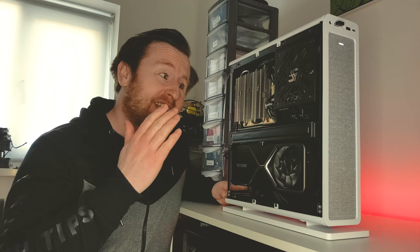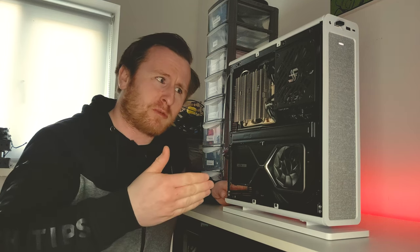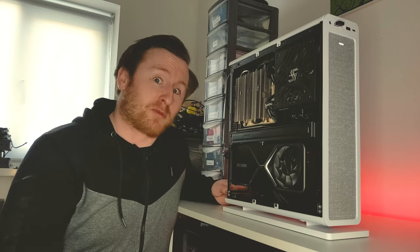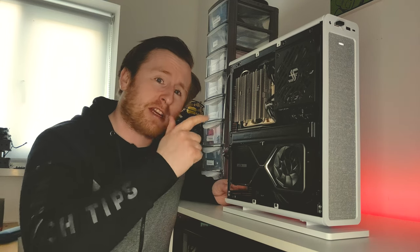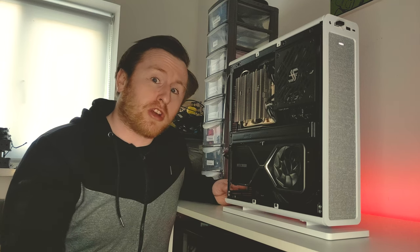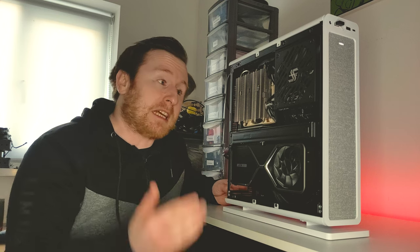Okay, so I think that is now actually the final build. Obviously, we had to make a couple of switches with hardware, including our cooler, our CPU, and memory, but it is in a much better position than it was before. I've actually been in the desktop and I've tested this, and the CPU was only hitting around 70 degrees C under a multi-core workload, which is pretty good going, so it should be good news for our gaming performance as well. So really, that's about it.